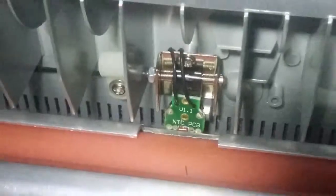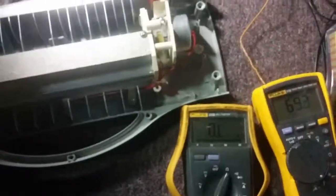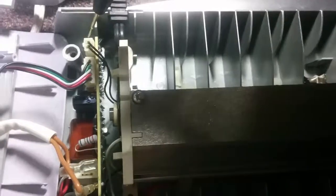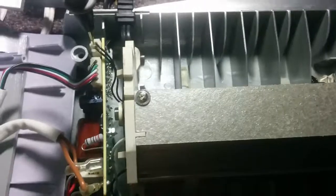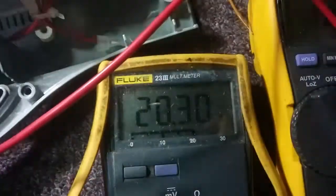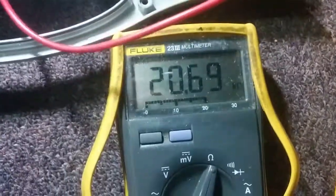I'm going to zoom out now. Those are the rollers. I've got a meter set to ohms, set to resistance, and then I've got another meter set to temperature. I'm going to give you a little example of how you can test a thermistor in one of these. Put one lead in there, the other lead — you've got your thermistor resistance. And as you can see, it's 19K and it's climbing as the heating element gets cooler with room temperature. That indicates a good thermistor.